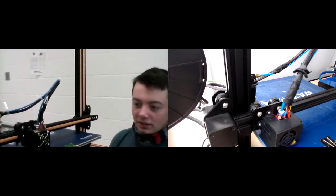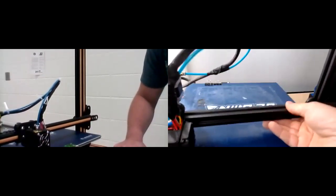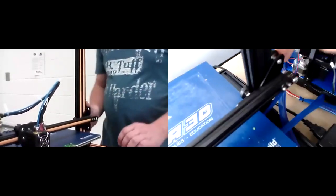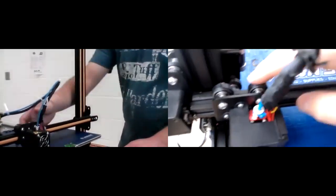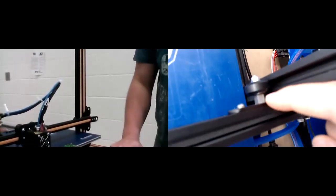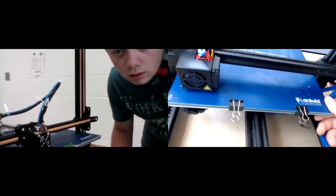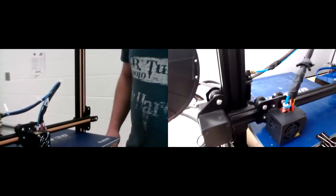It's slowly still heating up. So when you pull up and down on the sides of that gantry like I just saw you do, you can loosen these wheels, because if you pull up on this middle bar it can cause issues. So let's test and make sure that all of these wheels are nice and tight by moving your finger across them — they shouldn't move at all, they should be stuck in place. If they wiggle, that means it's loose and that can cause problems with your printing. Are they loose? No, they're all tight. Okay, because when you move it on the gantry, the wheels shouldn't just spin in place — if they spin in place then you need to tighten this little eccentric nut right here that pushes the wheels together. Same thing with the bed — make sure the bed doesn't rock back and forth. Is it tight? Yes, it's tight. Okay great.